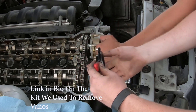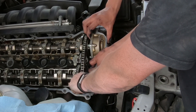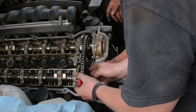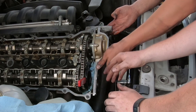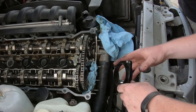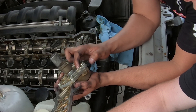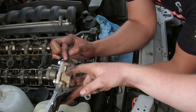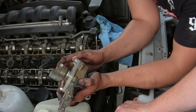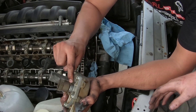The special tool is going to lock into one of the teeth on the sprocket, and then sit on that inner ring of the gear. In the previous video that we did but never posted, we had to redo the bearing inside this Vanos because he had a lot of play in the shaft, and the seal on the piston. We didn't do a very good job of recording because it was extremely hot. But this had a lot of shaft play - after redoing the bearing and the seal, now it's super sturdy and there's no play in the unit.